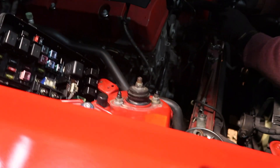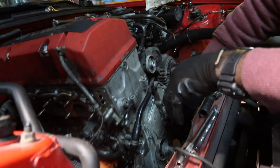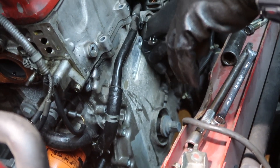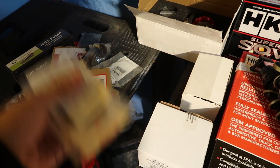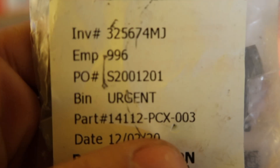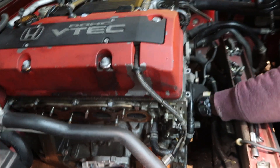Welcome back to the channel. Right now we're at the garage again, we're working on the S2000, continuing to boost this thing. Sheldon right now is removing the front timing cover so we can get to the pulse plates to change them. These are the pulse plates - you need them to run a KPro on a P1 Honda S2000, anything AP1, because you have to convert everything to AP2 just to run a KPro, which is insane but you got to do what you got to do.